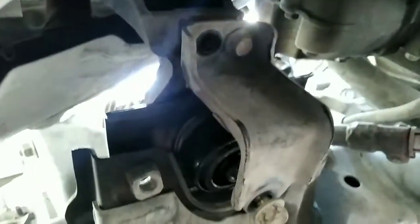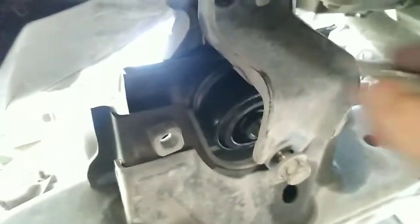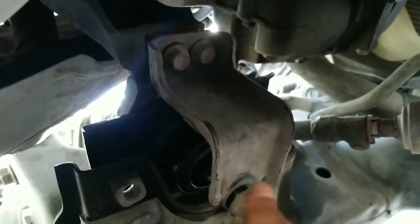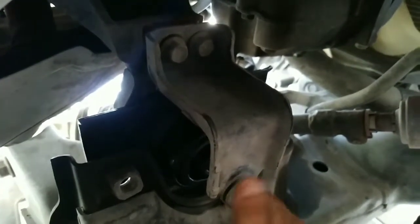Let's go ahead and put one of the size 14 bolts on the side. There's one. I'm moving it around so it lines up correctly so we don't damage the thread on the other bolts. Right here I'm gonna go ahead and do it by hand as much as I can, because that guarantees me there's no issues with the thread.